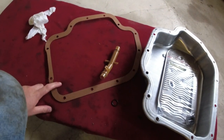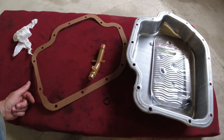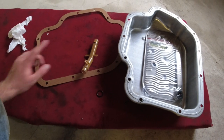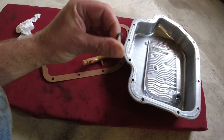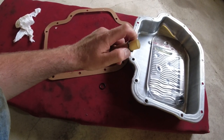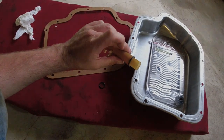Hopefully that's going to seal tight again. I'm going to put this all back in with the new cork gasket. I use Hylomar Blue on the cork gaskets as well — it works well, and I've never had a transmission leak again. From now on, I'm replacing these O-rings whenever I have these apart.